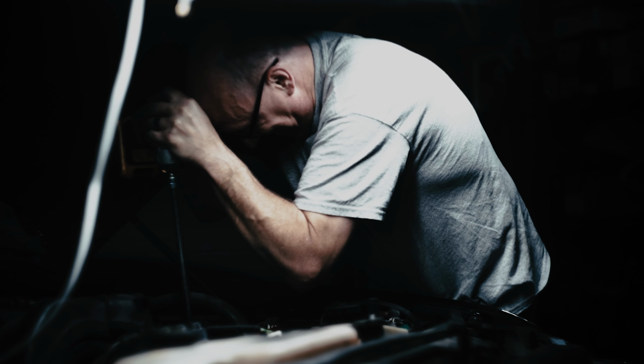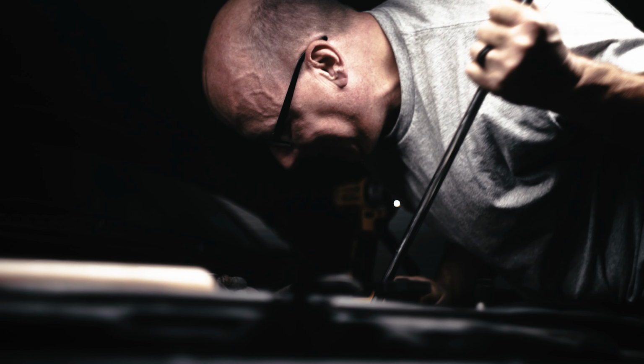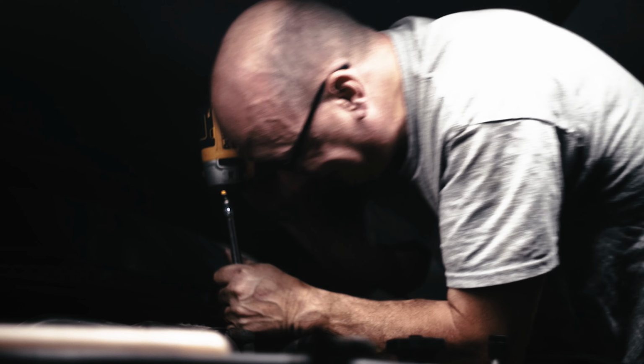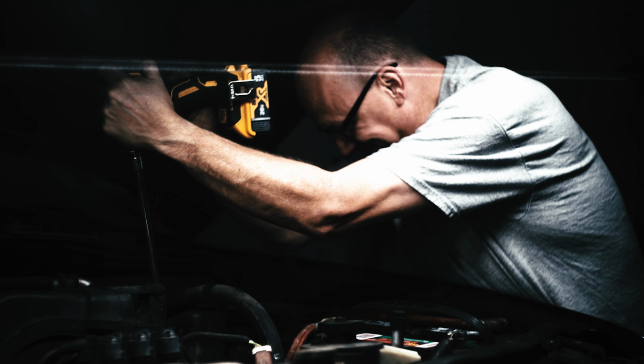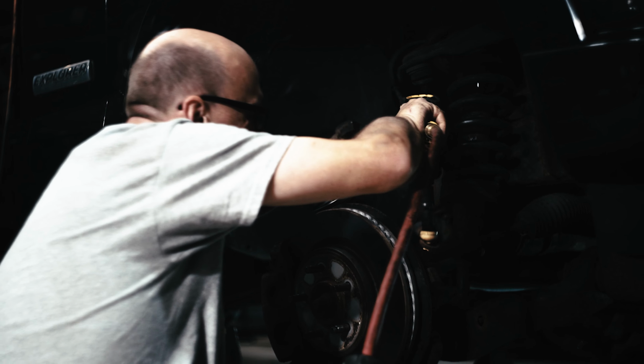Now I'm going to jump over to the driver's side and release that upper ball joint in hopes that I can gain enough flexibility out of the lower control arms to be able to get the strut in and out. And that, of course, is due to the sway bar. Oh, this one might have me beat. Rip it up! Really stuck.